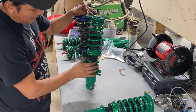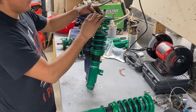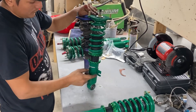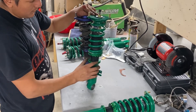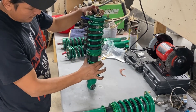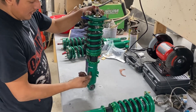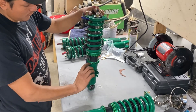If the car already comes adjusted for some height from factory or from the store, it should already be set up. But if I want to lower the car, I had to lower this part right here by spinning it around. What you've got to do is loosen it from the bottom, not from up here — this part is supposed to be almost right there from factory. If you want more lowering, you're going to lower it from the bottom. This adjuster right here is pretty tight, so you're gonna get it loose and then spin this thing down to see how much you want to lower.